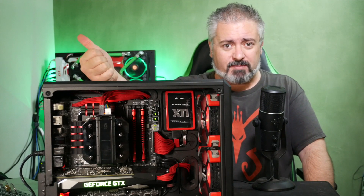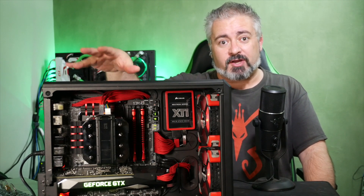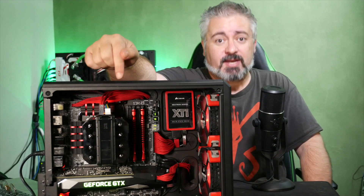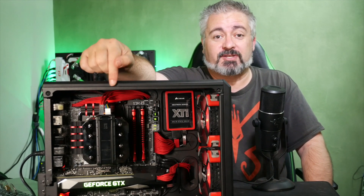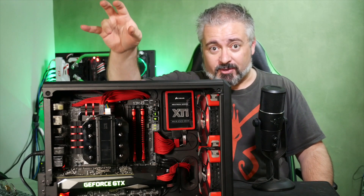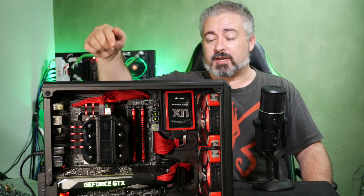That's fantastic! That Hex 2.0 cooler definitely gets the thumbs up. It's an interesting and rare bit of technology — one of the most compact ways you're going to get that kind of cooling efficiency and noise level. Many of the popular heatsink-and-fan coolers just don't fit in this case because they're too tall. You need thermal mass to pull away heat from overclocked CPUs, and the efficiency provided by the thermoelectric cooling makes this the most compact way to get that kind of cooling efficiency.